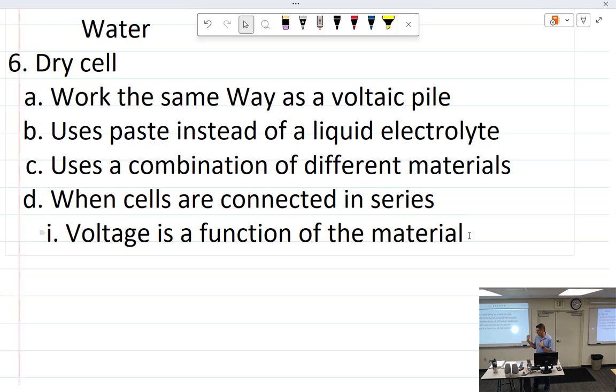So, jumping ahead, lead acid batteries that we're going to talk about, which would be what, primary or secondary? Storage battery, secondary. They have a voltage of how many volts per cell? 1.67 for a 12-volt battery. There's 6, there'd be more, so it's got to be 2.2, right? And a NiCad has a cell voltage of 1.25. Well, yeah, the book says 1.25.